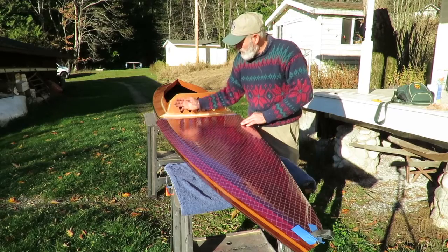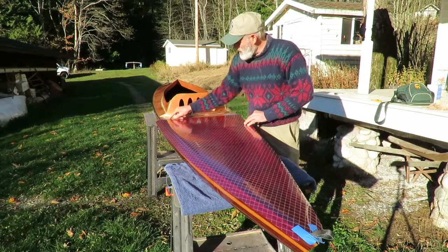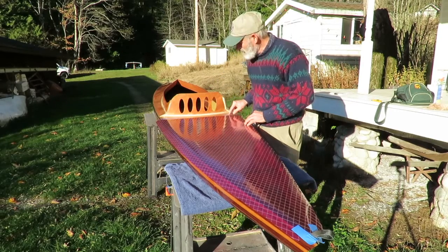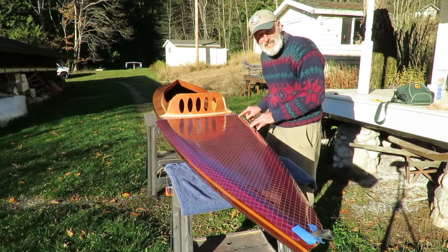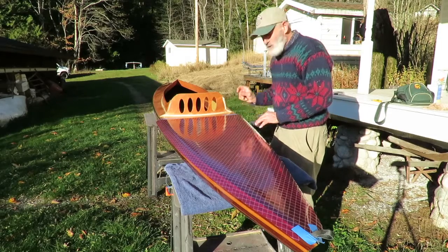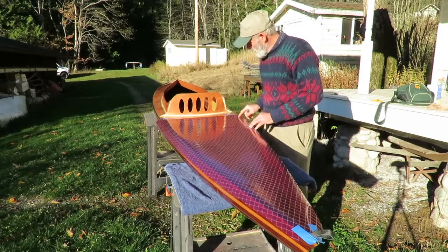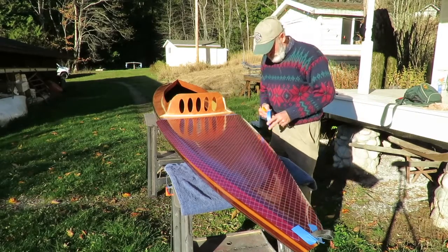Remove the blue tape, lift up the front edge just enough that we can peel back the orange backing on the double-sided tape that's across the back deck. Then we're just going to barely start the orange tape on the side decks, so we have a little bit to grab hold of there when we're ready to pull it back. We'll just pull about half an inch or an inch of that orange backing off on the sides. Not very much.